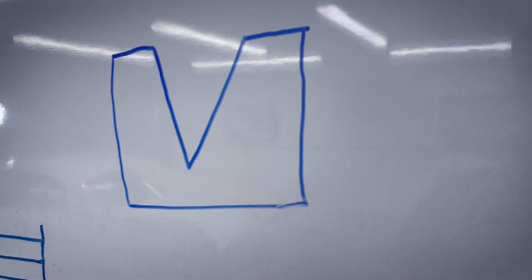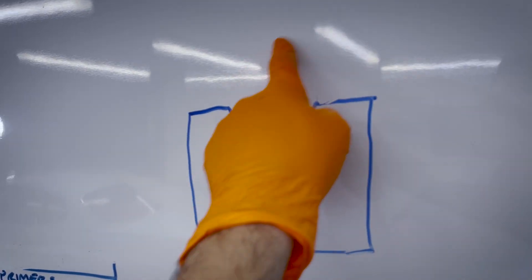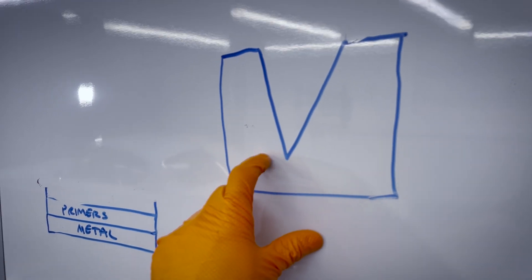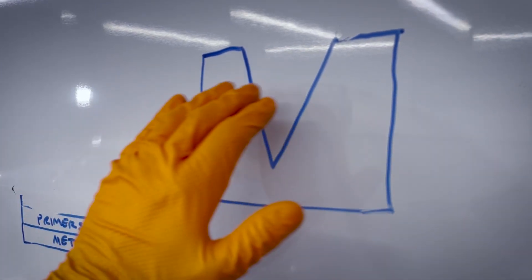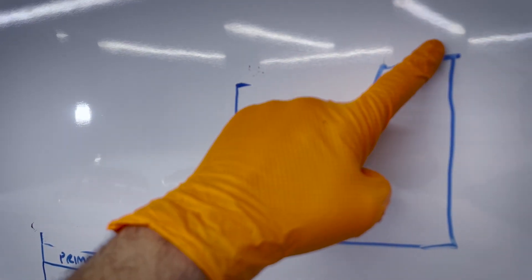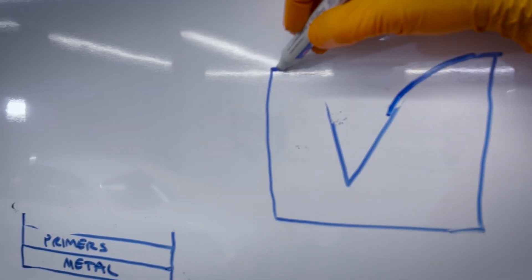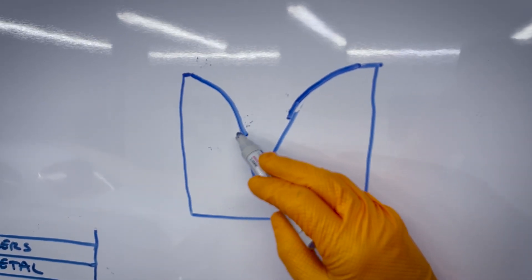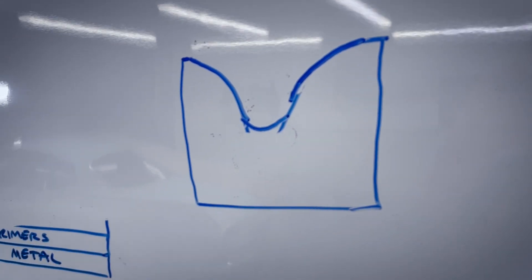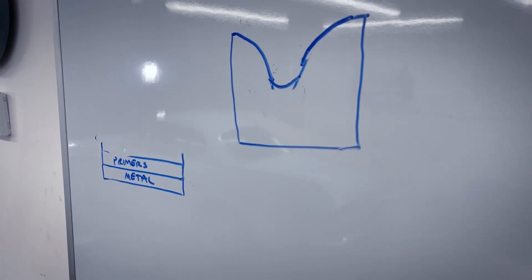On the nose of the car we have quite a deep scratch. The light is hitting these sharp edges and reflecting, making the scratch really obvious. We can't always get rid of the scratch completely because there might not be enough paint left at the bottom to work with - we could just take the top off, which will reduce the size of the scratch. But our main aim is to round off these edges so they're nice and curved. Combined with machine polishing and filling the bottom with oils and waxes, the way the light bounces around the scratch means it becomes hardly noticeable. So sometimes we can't always get rid of every single scratch, but we can reduce its visibility dramatically.